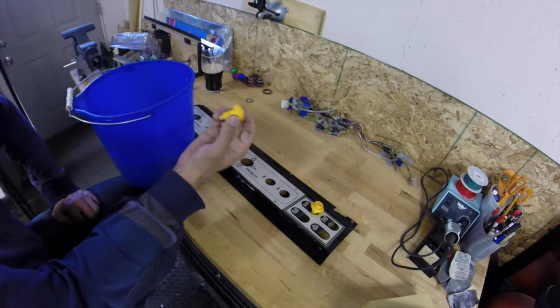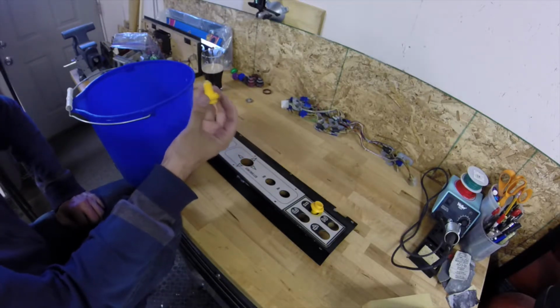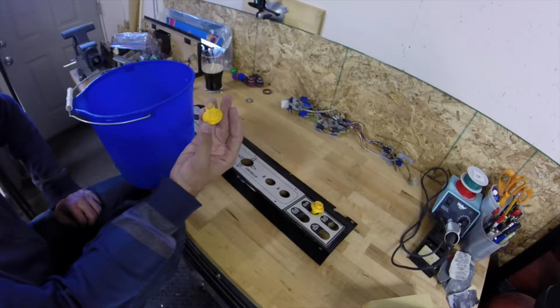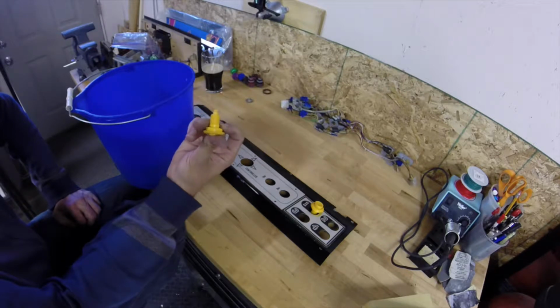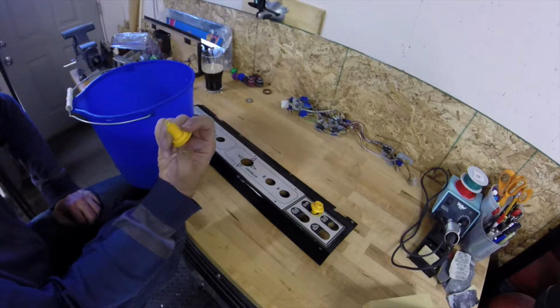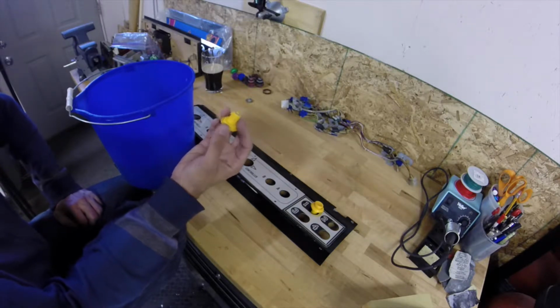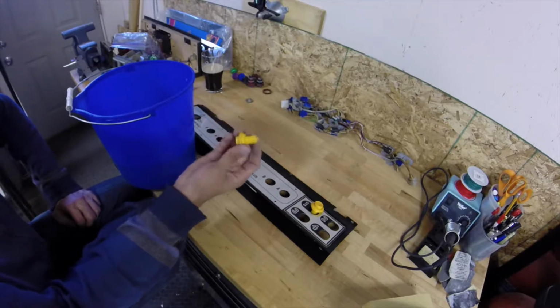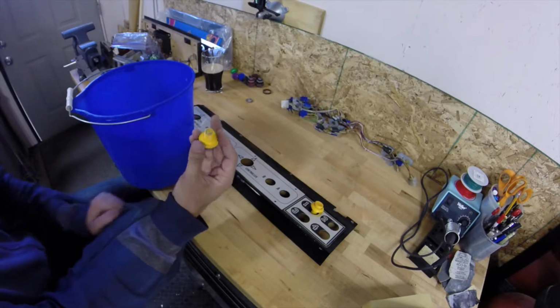Now you can take them apart pretty easily before you go through all this, but what I've found is a lot of times with these old buttons, the plastic just gets so brittle, from lack of moisture and just age, that you might be able to get this E-clip off of here, but you're going to end up doing some damage to the buttons. I've actually got a beautiful orange button from a Donkey Kong, the one that came on my Donkey Kong that I replaced, and someone had to stick a wire through here because the E-clip wouldn't hold.